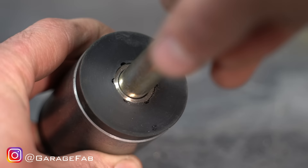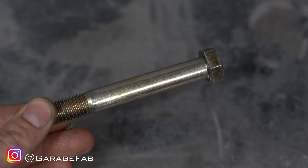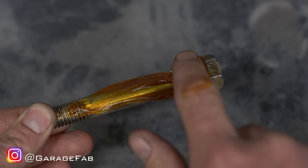There is no grease inside the sleeve around the bolt. Why? Because the inner sleeve does not move. I was certified by Toyota to work on Toyota products for a living. Occasionally we see trucks that have bushing through bolts rusted and seized inside the inner sleeve. If you would like to coat the bolt in grease in an attempt to prevent rust, have at it — it won't hurt a thing, but it's not required.